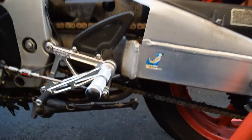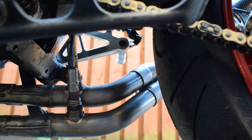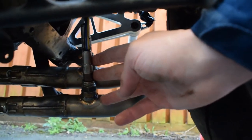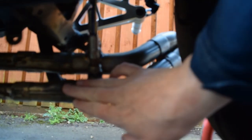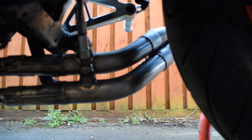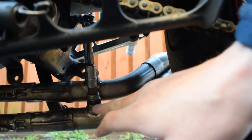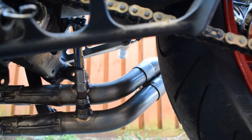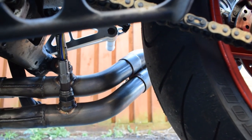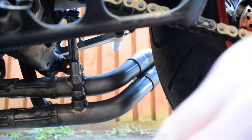While we're over the back side of the bike, actually, I can just give a quick look underneath and show you the dual lambda sensors that I'm running. If I can get it to focus. Yeah, so we have one lambda sensor in each of the 4x2 sections here. So we have our collectors up the front there. Sorry, get that to focus again. And 2 lambda sensors here. They're installed in accordance with OEM guidelines, so they can stay in permanently. And essentially the engine gets configured as a 0 degree V4 with the two outside cylinders and the two inside cylinders paired.